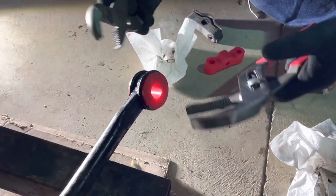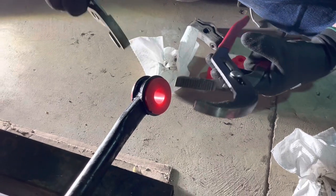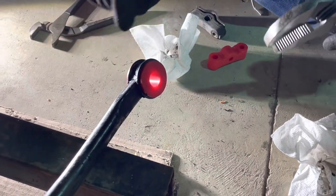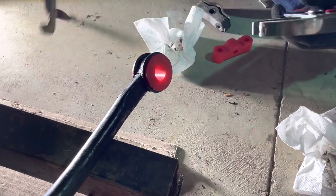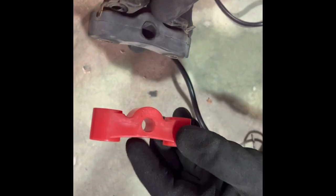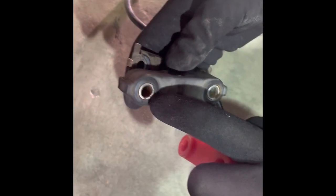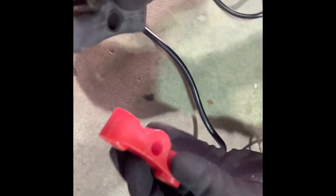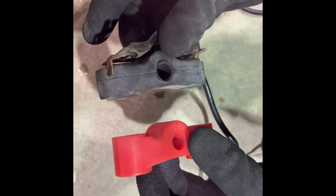So the time lapse — we tried everything. Ultimately what led to success was squeezing it on two sides with channel lock pliers. This thing is just kind of tricky to get in, but just get two pairs of channel lock pliers. Here's the old rubber bushing on the other side of the rod, and here's the polyurethane one. What you want to do is get these metal pieces out, put them in here, then attach the metal piece to the top of this, and reinstall back on the rod.